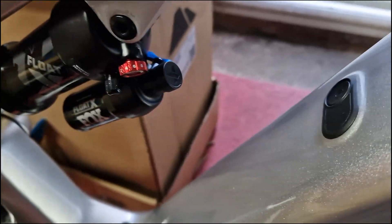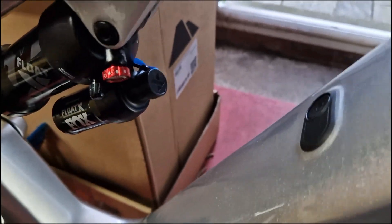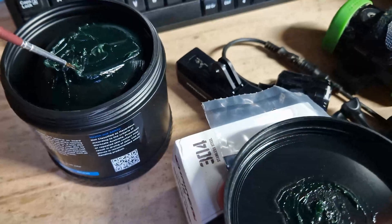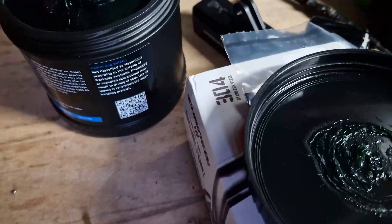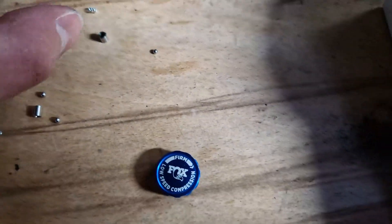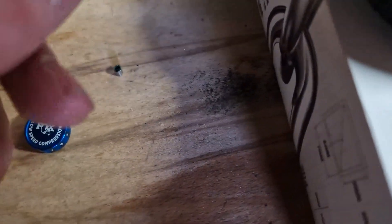This gives you the ability to have not just rebound, but also compression adjustment as well. You need to get the grease — not too much — and put it inside. It's very less so finicky; you then get a tiny little spring, absolutely diddy, and you drop that inside.